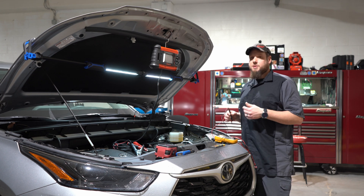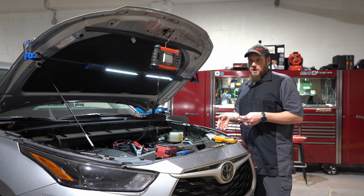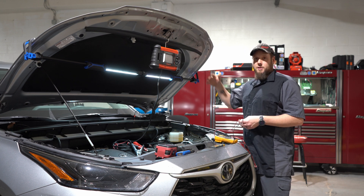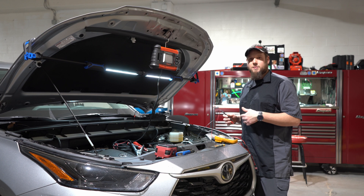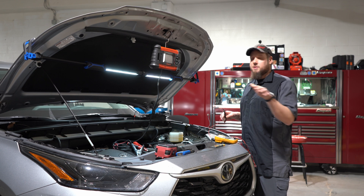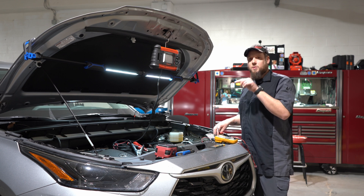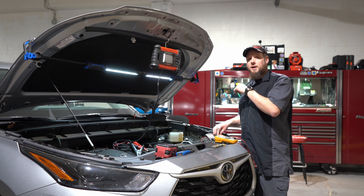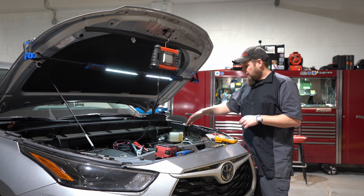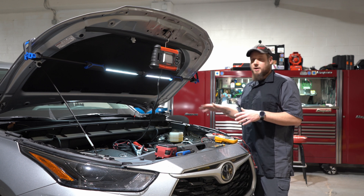What the book will say to do is use millivolts, and there's a chart that says if you have a 15 amp fuse and 10 millivolts, that equals a certain amount of draw. I think it's faster to just switch it to volts — normally you'll have zero across the board. If you have 0.001 to 0.003 or higher, don't pull that fuse. Make a mental note of what that fuse is and do all the fuses in the box, then do all the fuses on the inside wherever the other fuses are.